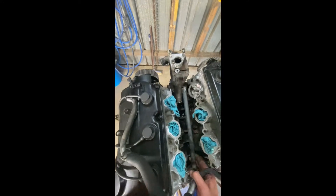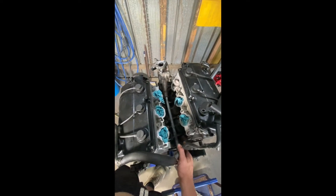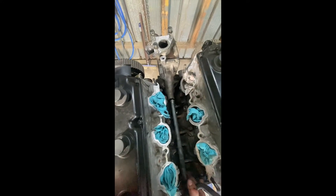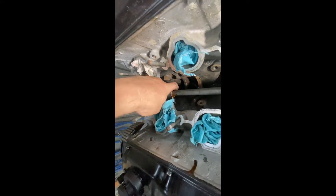We've got this crossover pipe assembly here. Make sure you give it a good clean up and replace the o-ring. I got the part numbers from Mitsubishi and gave those specs to a local seal supplier who were able to match the o-ring for me. I'm going to remove this oil crossover pipe just to give myself some better access. Next step is to take this rear crossover pipe and fit it to the new block. You will find that the bracket is going to obstruct it and it will not quite sit in correctly. I've had to tap that bracket — basically straighten it to prong out this way, put it in and then tap the top of the bracket back around with a panel beating hammer to make it conform to the back. You will need to edge it forwards probably about half an inch. I'll put a little dab of sealant around the base there — I'm pretty confident that's going to hold, but I just want to be extra sure.